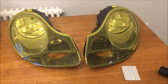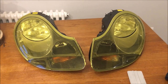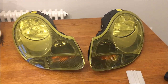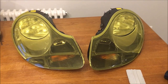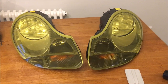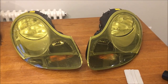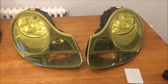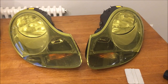Both units done, so I'm going to go and plug them back in. Just a couple of things to think about — remember this is temporary. It's a bit of fun and you'll probably keep these on until your loved one tells you you look a bit stupid, or you can't take the ribbing from your neighbours anymore. But when you do come to take them off, heat them up. If you rip them off cold you will take off the UV coating of the headlight. Heat them up with a hairdryer or a heat gun — don't go crazy, just soften them — then gently pull them back and you won't do any damage whatsoever.